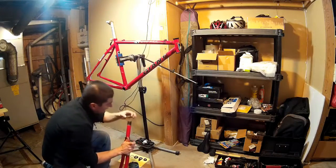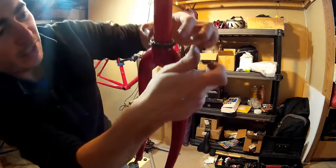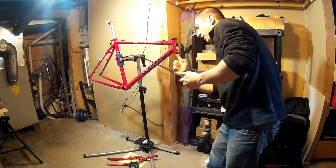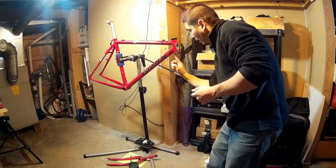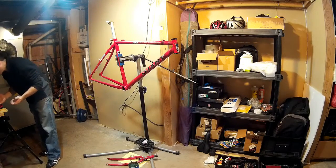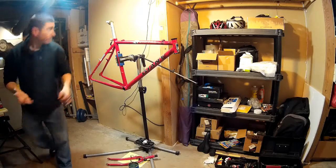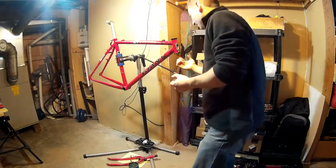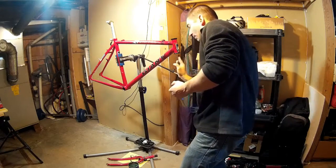On this bike the metal cage part goes down, so it will rotate on the crown race as you spin, and then this goes up into the bearing cup. I was also taking mass measurements while I was at it: fork — 822 grams; headset with all the pieces — 107 grams; seat post — 370 grams. That seat post is a part I really desire to replace because that is a lot of mass for a seat post.